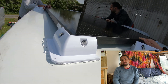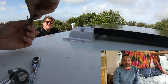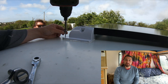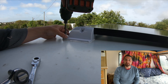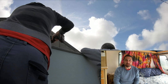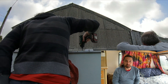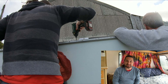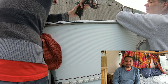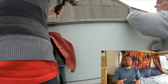If you're wondering, the adhesive that we used was Sikaflex EBT Plus. It's a 3-in-1 adhesive sealant and gap filler and once it has taken hold the bond it creates is incredibly difficult to break. Interestingly there's actually no solvent for it — once cured it can only be removed mechanically. We used Sikaflex EBT Plus extensively during the front end rebuild of our caravan and it truly is fantastic stuff. Once the panel was lowered onto the caravan roof we drove the roofing screws into the pre-drilled panel as well as down into the caravan roof to prevent movement. Most of the fixings down into the roof didn't really take hold of anything but their main purpose was to prevent the panel slipping whilst the adhesive cured.